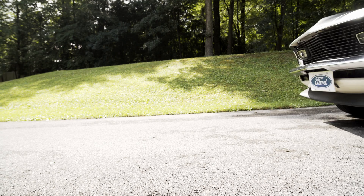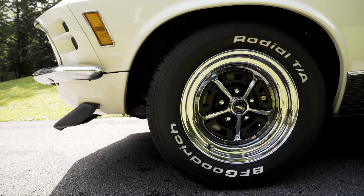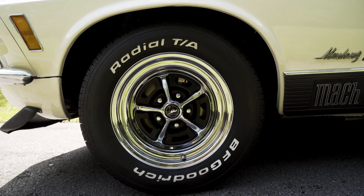All modern vehicles have a four-wheel hydraulic brake system. We're going to focus more on the disc brake system. How does the brake system actually work? When you press the pedal, a rod goes into the master cylinder, displaces fluid through lines, which goes out to a caliper, which will apply pressure to a brake pad, to a rotor, which is going to stop your vehicle. So what are the individual components, and how do they operate?